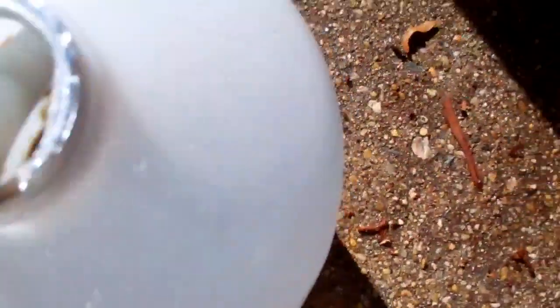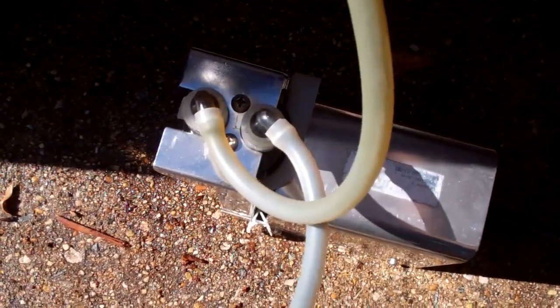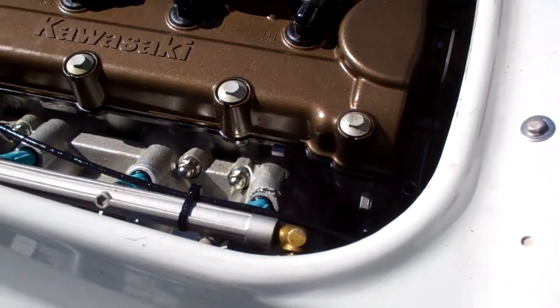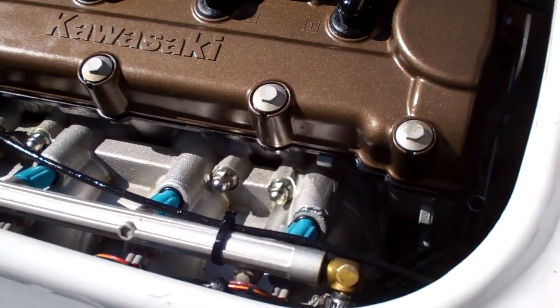I warmed it up before I started doing this and kind of killed two birds with one stone with that. I went ahead and put my fuel stabilizer in — I had already siphoned everything out of the gas tank. I took the fuel pump fuel filter out, checked it out, cleaned it, put it back, put in a couple gallons of gas with stabilizer, started it, and I've run it to heat it up. Looks like it's just going to take me a little while to pump the oil out. But my little pump here is working. I got all the oil pumped out — got a little over a gallon out, so I'm pretty confident I got most of it.